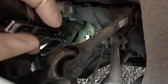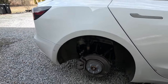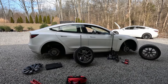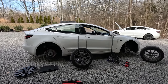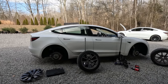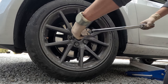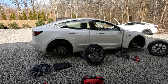There's an oil filter right below the axle, just like a spin-on oil filter on a gasoline engine. But why does an electric car's motor have an oil filter? Gasoline engines are dirty — they suck in dirty air, the filter isn't perfect, combustion byproducts get into the oil, and you have to change the oil every 3,000 to 10,000 miles. On a Tesla, the electric motors are produced in very sterile environments, almost like a surgery room, built by robots to near perfection because it's a sealed component — no dirt in, no dirt out. The filter is there purely from the manufacturing process; if there were any contaminants, they get trapped in that filter.